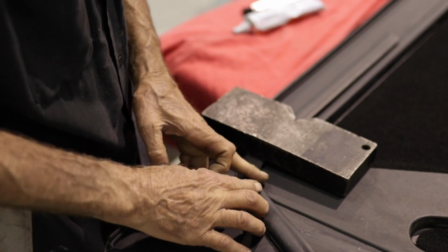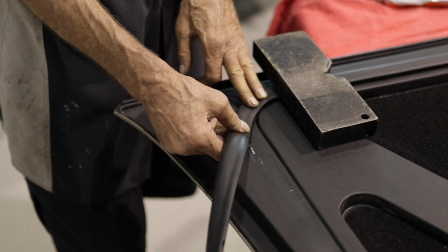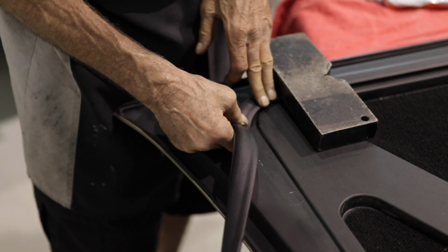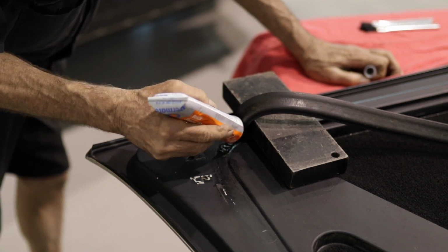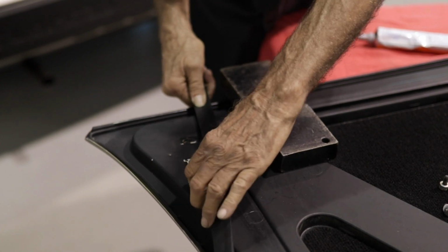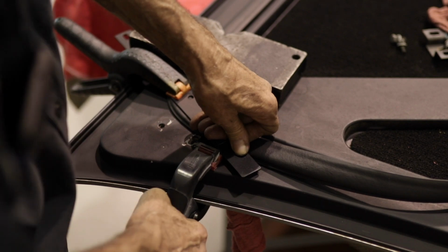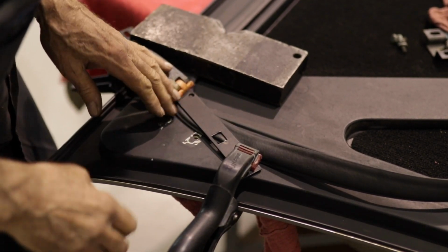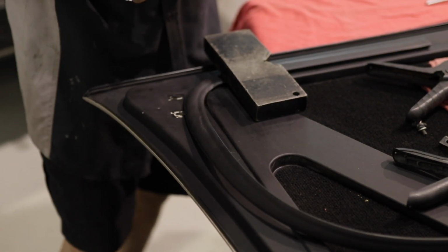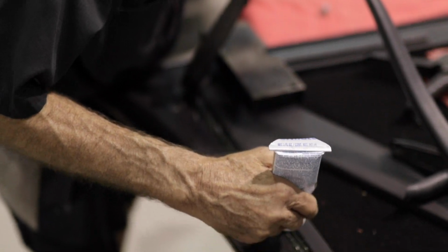Visually determine a point about halfway through the corner and apply the adhesive to both the hood and the seal to just about that point. And let this newly applied adhesive cure for about 10 minutes. At that time, work it around to that halfway point, holding it in place so you can apply the clamps as shown. Allow the adhesive to cure completely, usually about 10 minutes, and then you're ready to continue. As beforehand, lay down a strip of the black weather stripping adhesive as shown on the side of the seal with the vent holes and set it aside.